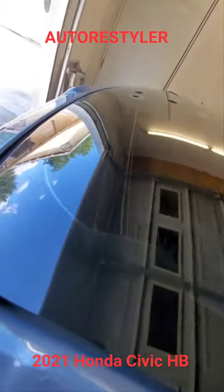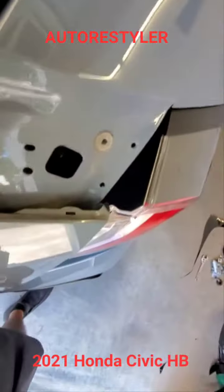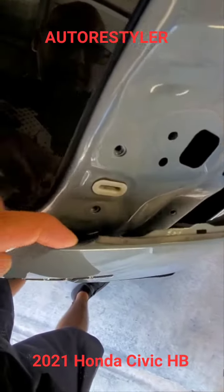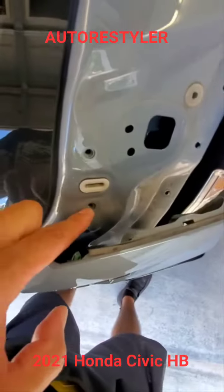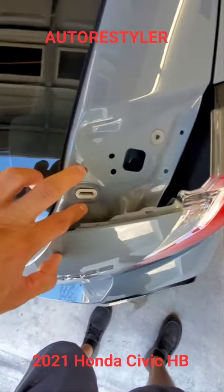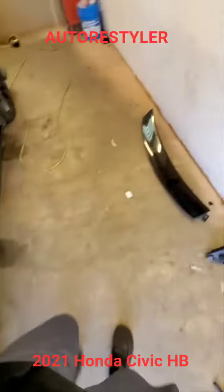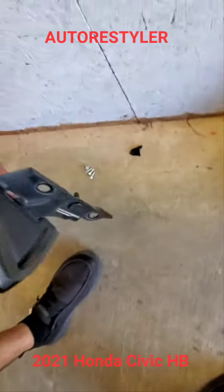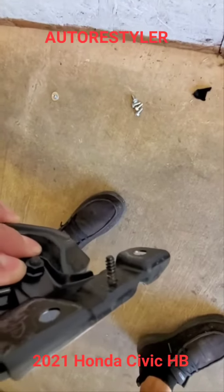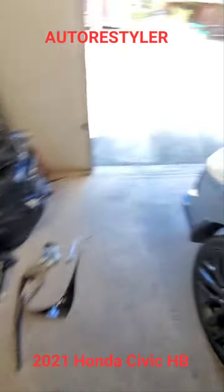This little piece right here has plastic clips also. Once you pop that off, all you gotta do — there's one right there — just pop it. You don't have to take this side off, just pop it enough. There's two ten millimeters right here, and then you'd need to pry this guy up too — it's got another stationary clip right here. Do that on the other side and you get it off.